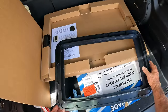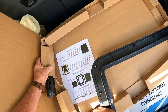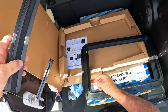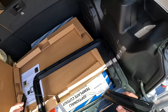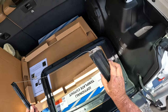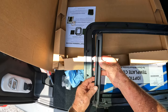Now that we have the outer frame secured in the door, let's do the inner frame. You'll see on the inner frame that at the top it's a little wider than at the bottom — that's for how the shade goes in. The wide part is the top. Take your shade out of the box and put it in the inner frame. The top portion with the actual shade mechanism goes in the top portion of the frame. Make sure you get the handle to pull it down facing out. Get the strings right — they go on the outside of the frame. Then take your little cords and tuck in any excess cord, and put the bottom portion in.